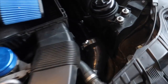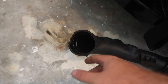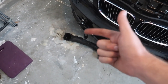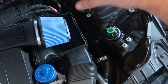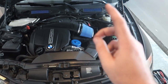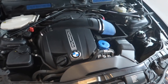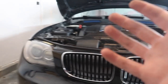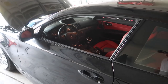Just like that, we have the new charge pipe in there — no more boost leaks. We are kind of missing the gasket that goes in there; I think it flew out or the charge pipe never had it. N55s are supposed to have it, right? Let me know down below. The clip fell but I was able to find it and get it back on, so it is functional. I might have a slight boost leak if there's supposed to be a gasket, so I'm going to order that from Burger Tuning as well. This engine bay is really coming together. Now we need some proper cooling, so let's take out this intercooler and head over to my dad's place — we'll need a jack to install this big intercooler.